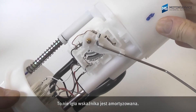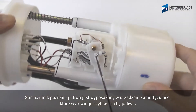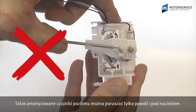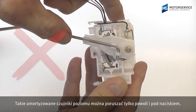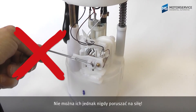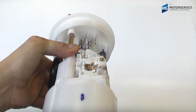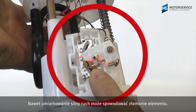In these cases, it is not the needle in the tank indicator that is damped, but rather the fluid level sensor itself is fitted with a damping device that offsets the quick movements in the fuel level. These damped fuel level sensors can only move slowly and with effort. They must therefore never be moved with brute force, as even a moderate application of force can result in breakage.